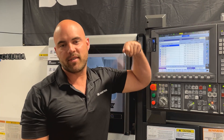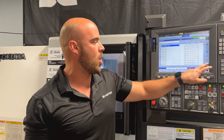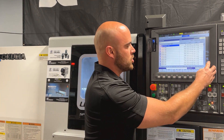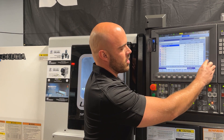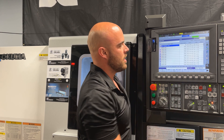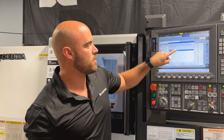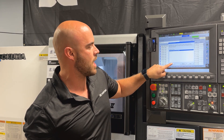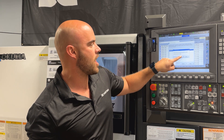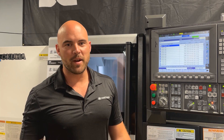One last thing I would like to cover. I know you can just yank the USB out of the drive but I think it is a good habit to always remove hardware safely. To do so, you will go into your little gear button on your vertical function key and then select remove hardware. You will see your USB mass storage device — hit stop, confirm devices to be stopped, and say ok, at which point you can remove it. It is really that easy.